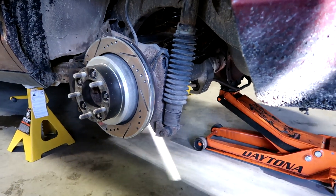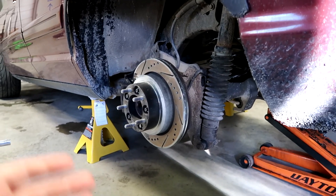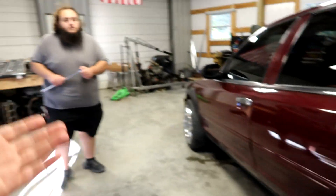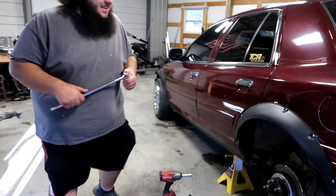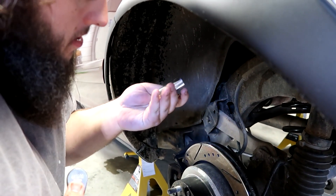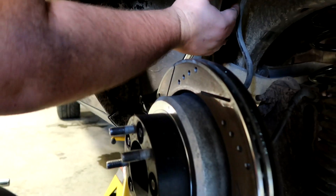All right, so first order of business is obviously jacking up the car. You don't want to put the jacks on the rear diff — you want all that to hang. Will's going to go ahead and get all the socket sizes we need. We'll let you know all that. I went over the control arms — how are you pronouncing them? What's the actual company name? ADTR. Anyway, we're going to go ahead and break these loose. What size is that? 18. So you can fit them on. You've got a lot of rubber up in this inner fender.